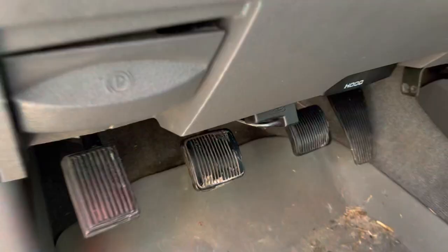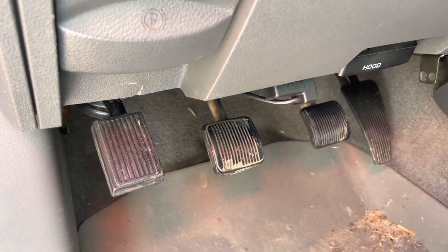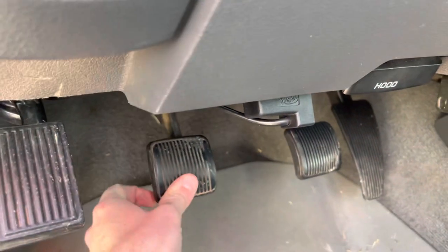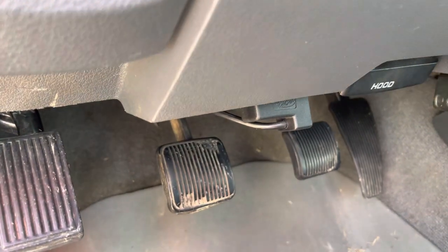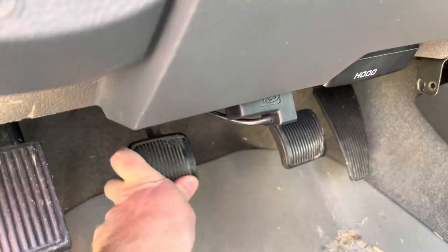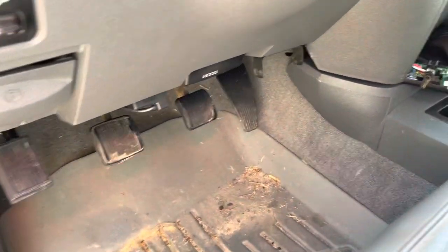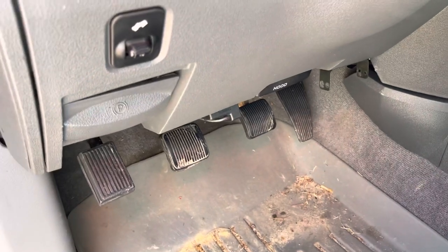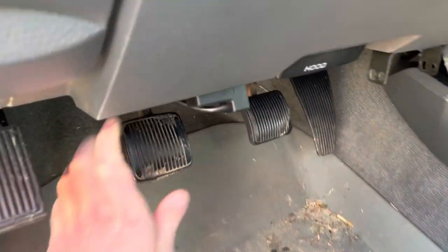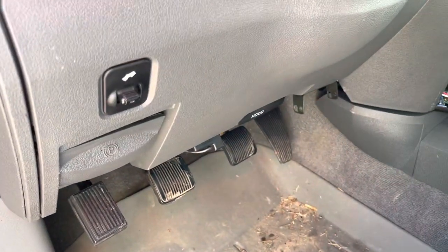Fast forward to March 2022 — about four months later — I started noticing my pedal getting soft again. I think I have a small leak of sorts, either air infiltrating or brake fluid exiting the system, even though I don't see any visible evidence of a leak. The firmness point in the pedal travel had shifted about an inch further down. In first gear and reverse especially, if the wheels were moving at all, there was a grabby, notchy feel going into gear — possibly because the clutch was maybe two percent engaged.